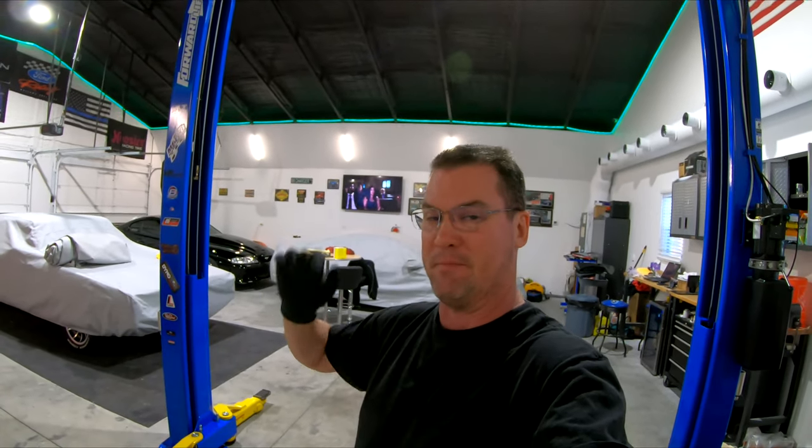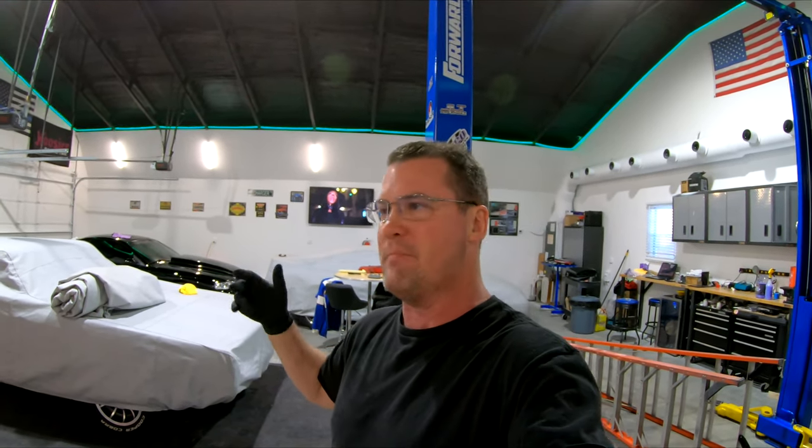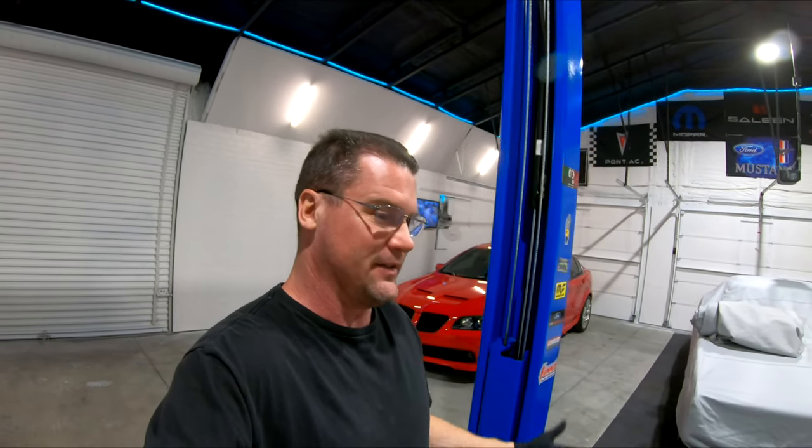This will probably be the last video for 2022. The Charger is up and running good — for 2023, I'm going to pull the rear end apart, put a Posi-traction unit in it, a TrueTrac type of thing, and different gears. Getting rid of the 2.76 gears and going to a 3.70 or 3.73 — that's going to allow it to spin both tires now and it needs more gear. Instead of 2.76s, with 3.73s that thing is going to come alive. The Mach 1 is pretty much ready to go, and the Pontiac — nothing wrong with it, it's fixed. Right now everything's pretty much up to speed.